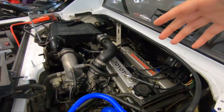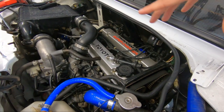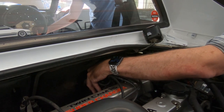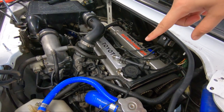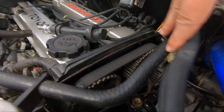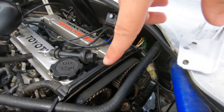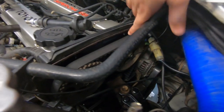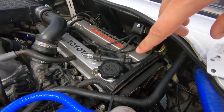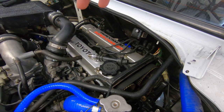The spark isn't the only issue we've got with the motor. We had a quick look online and one of the issues is the cams might be upside down. You can see in here - these are the indicator lines and everything is lined up to the gears - but on the 4AGE they're actually supposed to be upside down. The cam indicators are supposed to be facing downward, which admittedly they're not at the moment. It's probably because the cams are upside down, so that's something we're going to have to work out today as well.